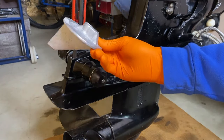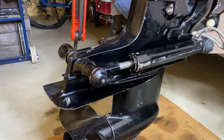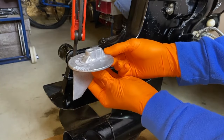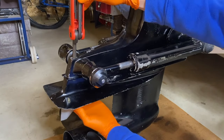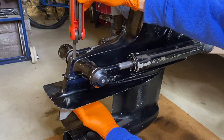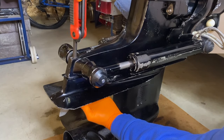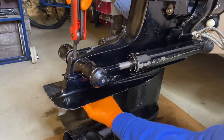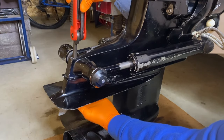Next, go ahead and grab your brand new anode. In our case, we operate in fresh water and we chose magnesium. I highly recommend if you are operating in fresh water, purchase the magnesium anode kit as opposed to the aluminum kit — magnesium is what we recommend. The way this is going to be installed: I'm going to position it as shown here down below and simultaneously turn the bolt clockwise. Do not cross-thread the bolt into your new anode — that would not be good. Once you align the thread, it should screw in extremely easily. If it's not, go ahead and turn it counterclockwise, back out the thread, reset the thread, and begin turning it clockwise again. As you tighten this, with my left hand down below I'm ensuring that the anode itself is being guided up and into its insert and not going in crooked.